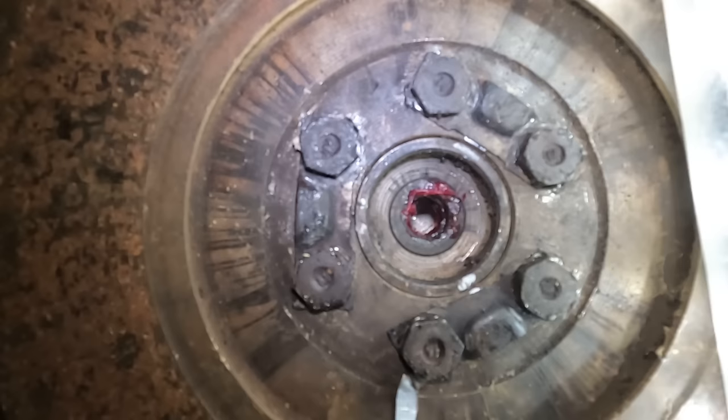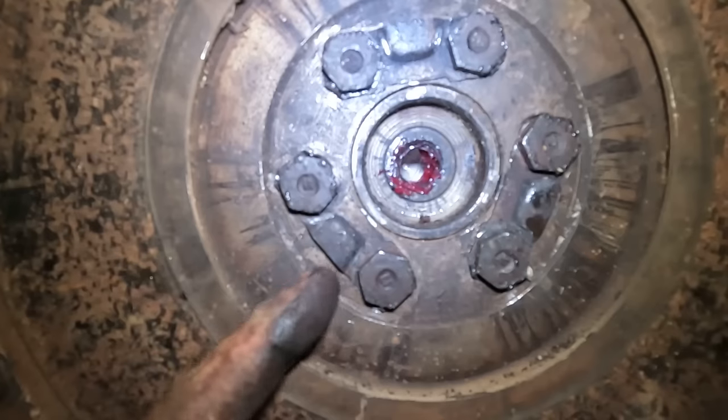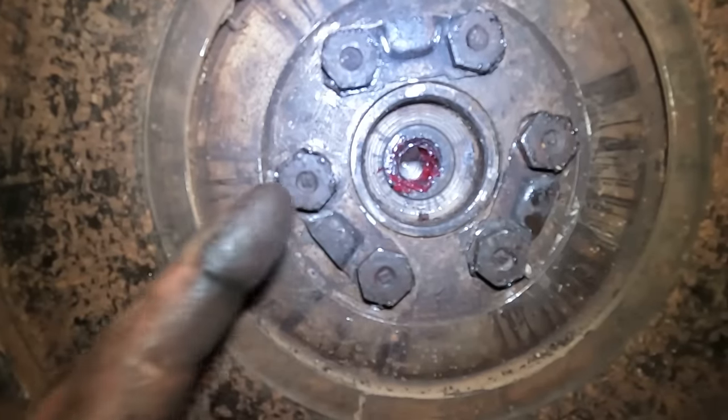Once you start bending it a little bit, then I can use the other end as a ramp and tap the screwdriver. And that gets it most of the way. Then I can use it backwards again, use the tip on the edge to drive it in place. There, got them all. Every bolt has at least one tab on a flat, so we should be in good shape.